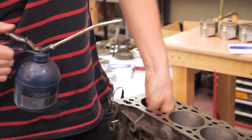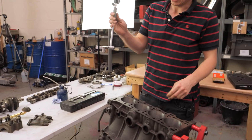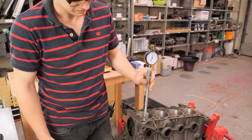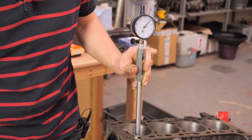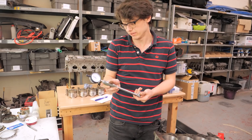That's a problem with a 1.6 - you can barely get your hands in it, you need bigger bores. When we put this in, we'll rock it across and we'll look at our dial indicator, and as it's moving you'll see that there'll be a maximum amount it goes to. That is the number we want to note down, and that's the number we'll be doing the maths on.